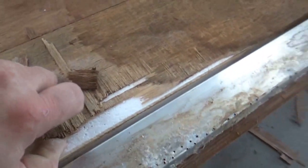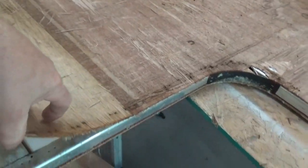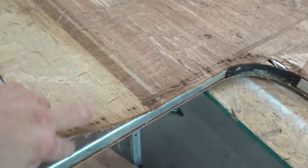That's all they do. So most of this is stuck on here, and if you start tearing this, you'll start tearing into the foam. So we may be able to just sand this down — this is tight, that's just a water stain. And we'll put some mold kill on it just to be certain, and then we can just lace over it with another piece. But if we start tearing that, we're probably going to tear that foam out. So we will keep you updated.